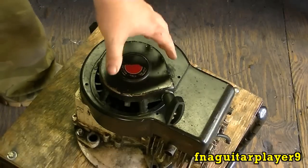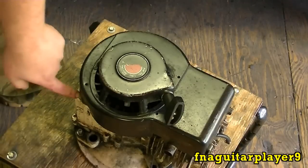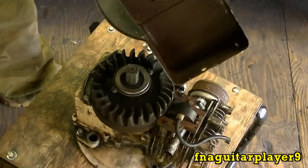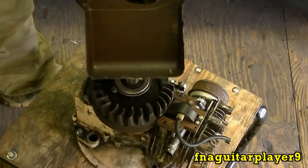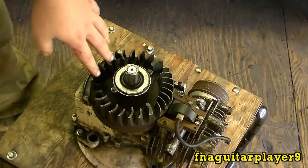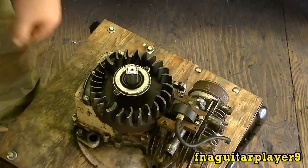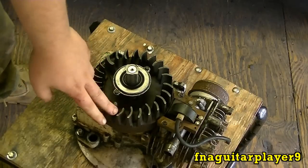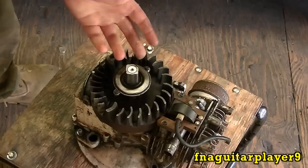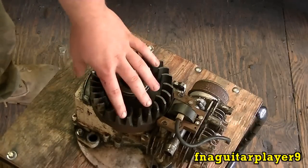The first thing you do is take out three bolts — there's one up here, one here, and one here — using your 7/16 drive, and your whole flywheel cover just lifts right off. There's your recoil mechanism. Now we've got to pull the flywheel. The first thing you've got to do is remove the starter cup. You'll also notice this has a cast iron flywheel on it. Most of your push bar engines will have an aluminum flywheel.